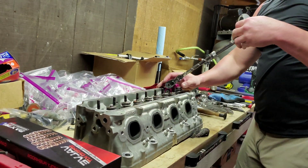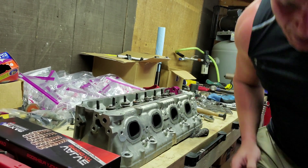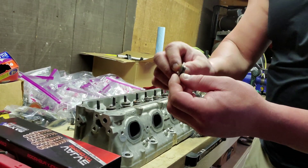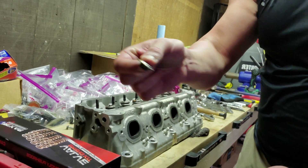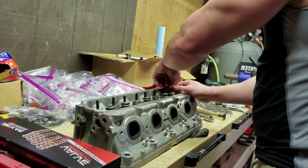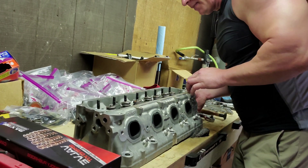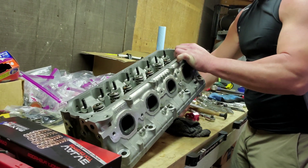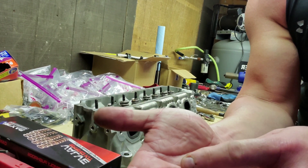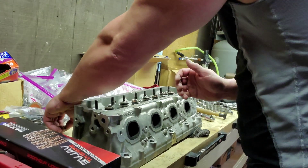You can see that's all it takes. We can release the conical spring and put that over here. Here is the retainer — that's just the retainer on top of the spring. Now we can unscrew the valve spring compressor and take that off. The keepers generally fall down, and that's in fact exactly what they did. If you want to look at the keepers, they're just a little conical shape. These are the things you don't want to lose — they actually are quite easy to lose.